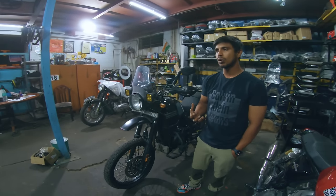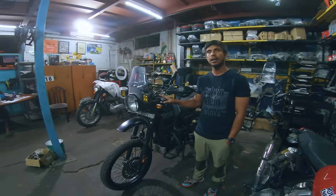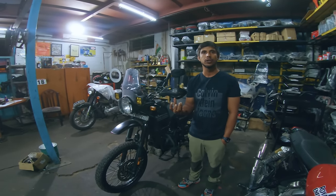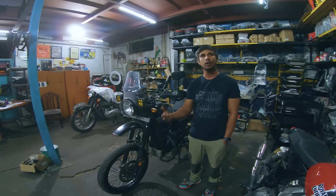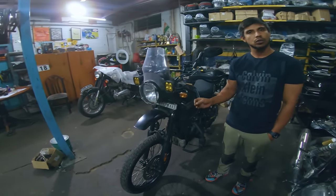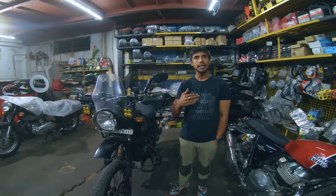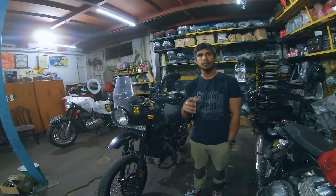Basically, for this bike particularly, it has crossed 30,000 kilometers and it is going to be 3 years. In 3 years, there are a lot of rubber components which tend to break and crack, and then the failures will start. Like with hot and cold temperatures near the engine side, or the fork, which is in action all the time whenever you are riding. So we have inspected everything socket to socket, rubber components, moving components like bearings, engine oil supply, cleaned out all the oil vanes, filled with the new oils, and we have checked the oil supply as well.